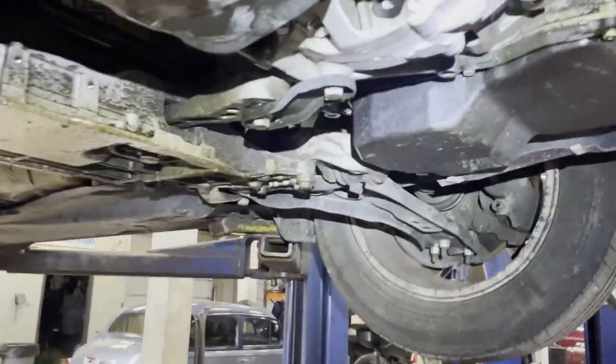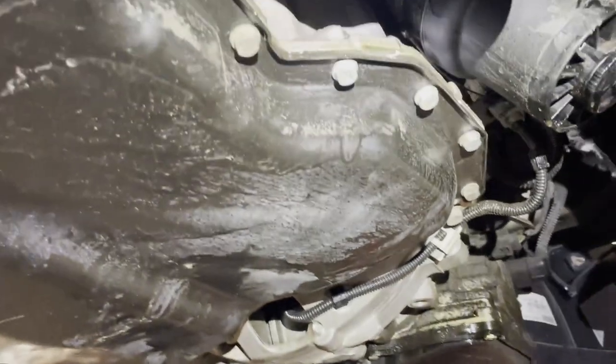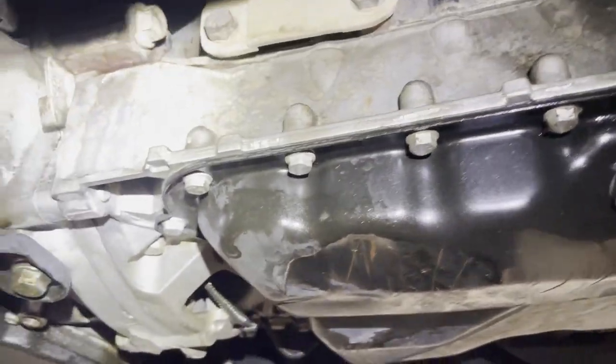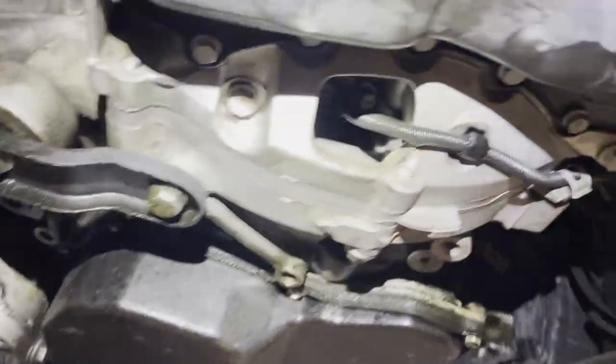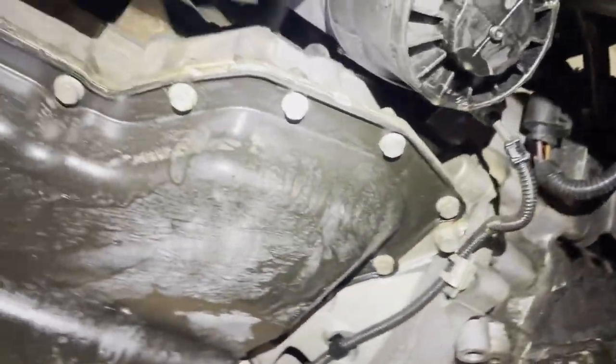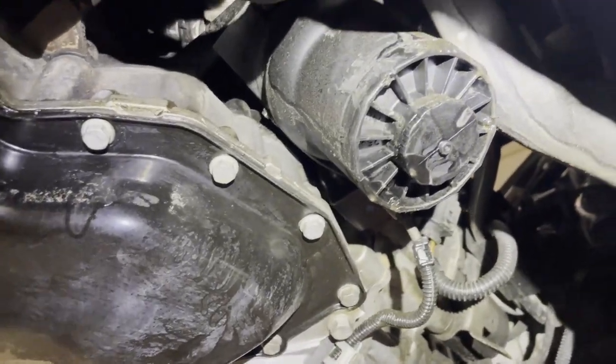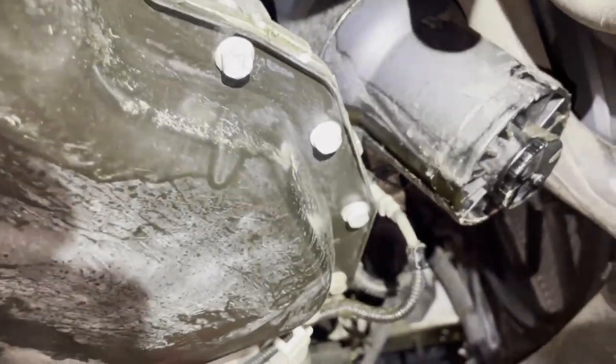Alright everyone, I got it all cleaned off. Since I was suspecting the oil filter housing — it's pretty clean up there — so now I'm just going to start it up and let it run and see where the oil comes from, because I don't want to guess at this one. Looks like the oil filter housing is the culprit. You guys see that?